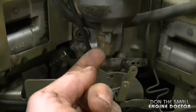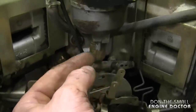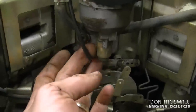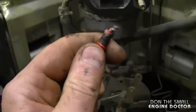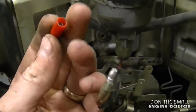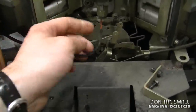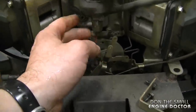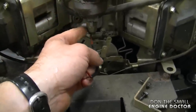If there's no power going to this solenoid, it kind of acts as a valve that closes the jet inside the carburetor — it will definitely limit or restrict heavily the amount of fuel that can go through. There's no way this tractor will run if this solenoid is not connected to 12-volt power. You can even see it's been chewed on the bottom part, so I'll have to tape this up. I'm going to replace the wire with a butt connector. The telltale sign the wire is damaged or the solenoid doesn't work is that when you turn the key on, you will not hear the solenoid click.